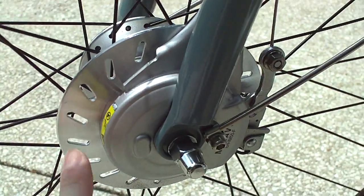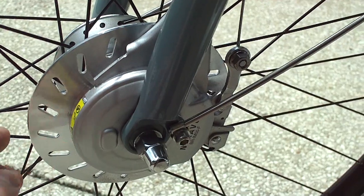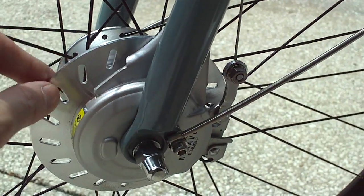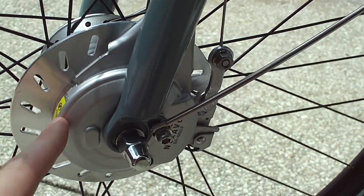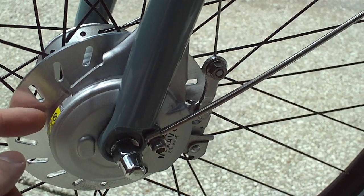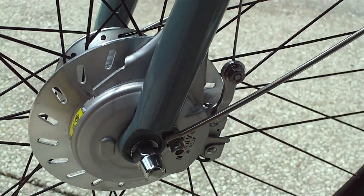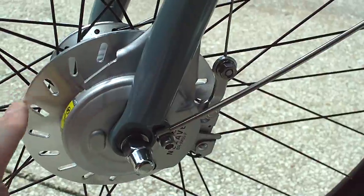One of the other things that's a little bit different on this bike is it's got a roller brake system. The brake is inside here. Upon first glance, a lot of people think this is a disc brake system, but there are no calipers — this is just a heat sink out here. The roller brakes grip onto the inside part of this covered section, they create a lot of friction, and this heat sink just helps dissipate some of the heat.